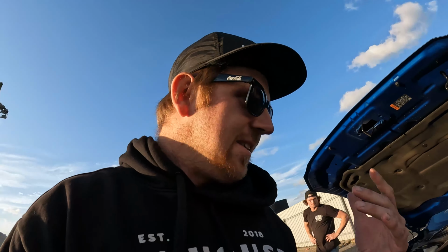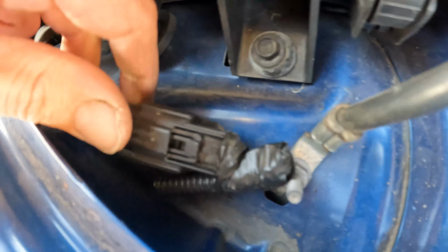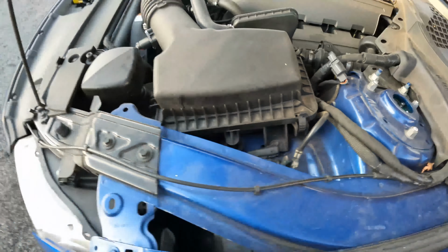All right, so we're here. I'm gonna quickly go through the process. He's gonna give me a hand, doesn't know what he's doing. Okay, so this is what we gotta do. Just letting everyone know, this is the front plug. Chelsea Dunford actually told me this is what you gotta undo. There's this little puppy down here, that's called the front plug. So you just need to unclip that, literally like that. That turns off all your stabilities and all that.